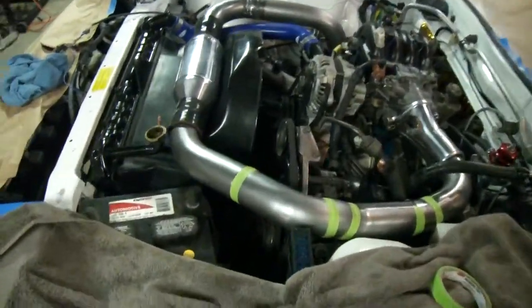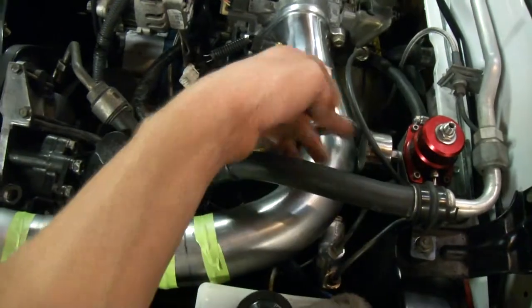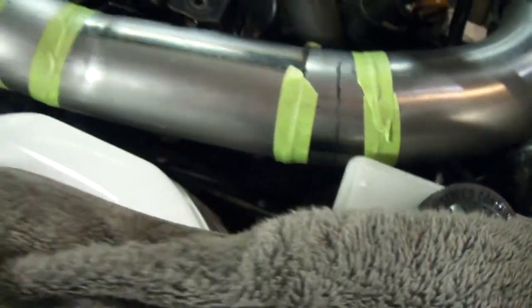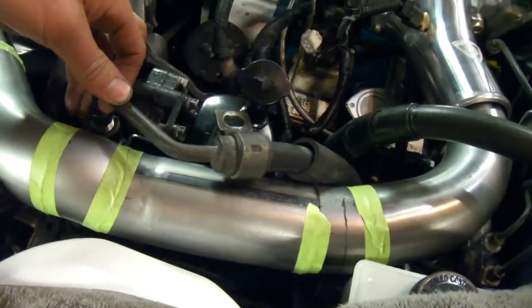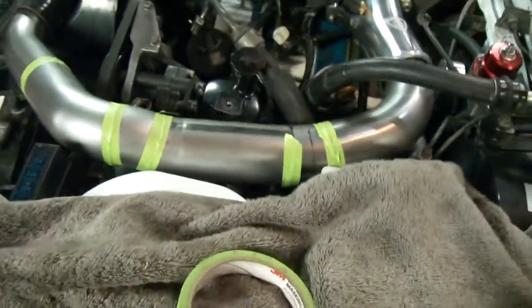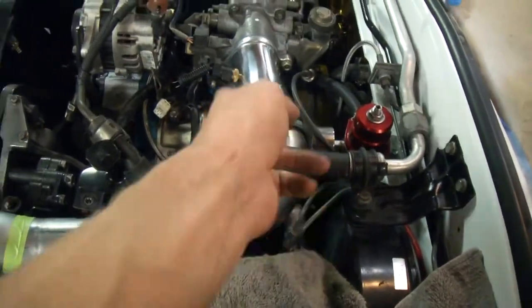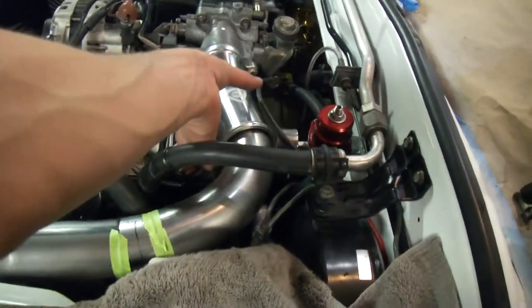Made some more progress - had it done to here, another pie cut. The 90 bend fits in nice and tightly, doesn't touch anything. This is still too long but I'm going to cut it. Got it all clearanced - there's some air space between it and the brake line. The power steering line should fit back where it was. You can flex around the intercooler pipe just because it's a little bit tight. Had to take it off just for ease of entry. Once I get the 90 fitting I'm going to see if I can cut it here and run the 90, or most likely just get a straight fitting, shorten this guy up, and dump them together. It'll just barely miss the oil filter - the one thing that sucks is you'll have to take the intercooler pipe off to change the oil filter.